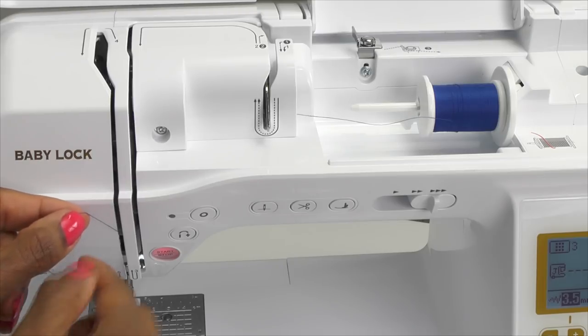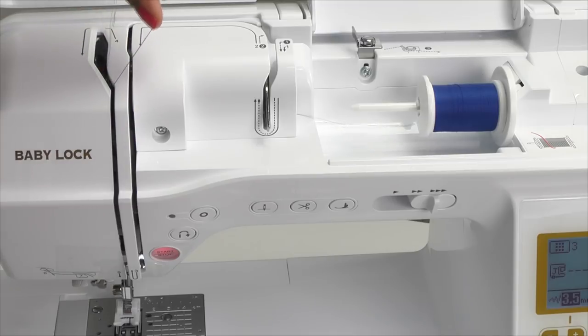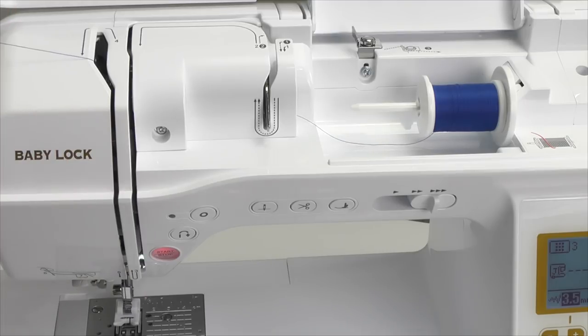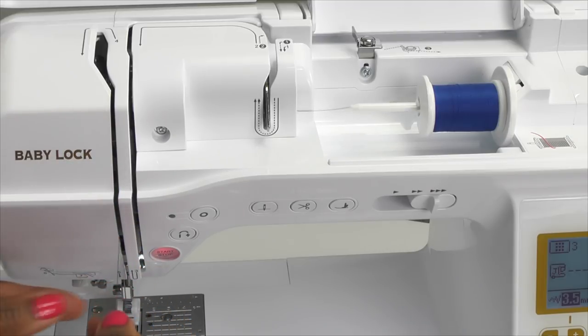When you're going up in this groove, you're going to make sure that you're leaning your thread over to the right until you get to the top. Then you're going to shift over to the left to go down, and the reason we're doing that is because there is a metal hook inside this groove that the thread is latching to. Continue going down, leaning your thread to the left, down to number five.